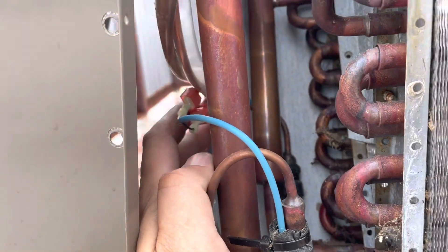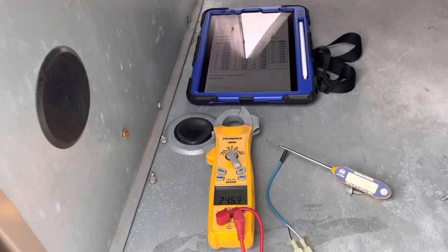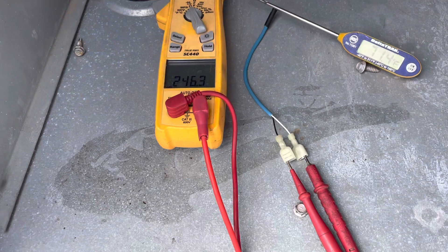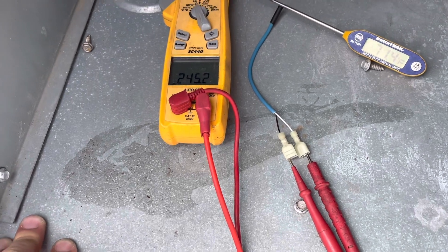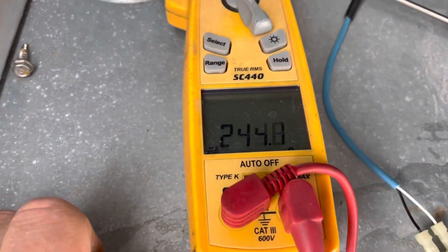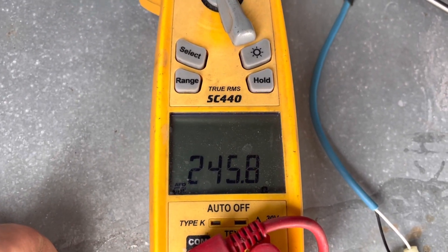See if they're bad, if their readings are okay, and we're going to go from there. I got the sensor out — and don't make fun of my meter leads, I just broke one and had to improvise. Apparently I didn't have a spare black one, just a spare red one. So on this sensor we're reading 245 ohms.